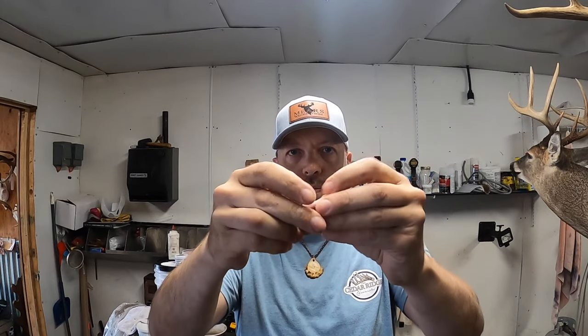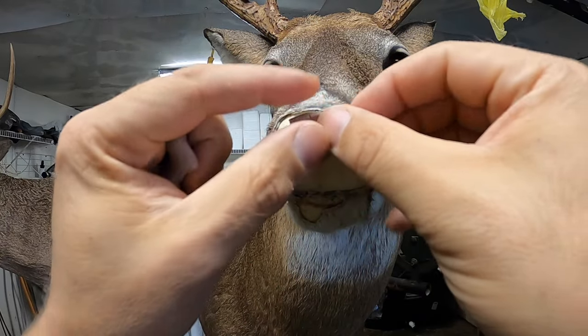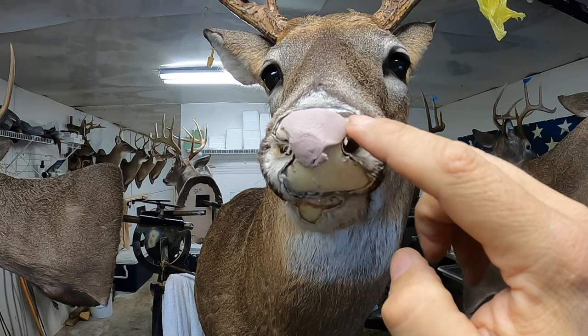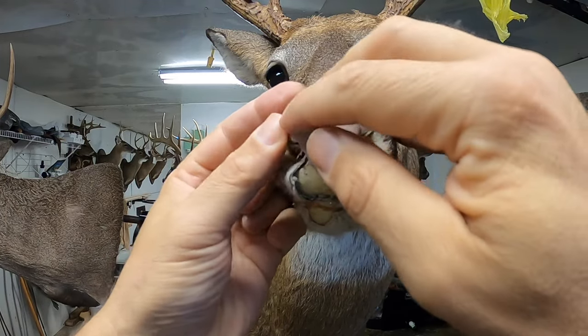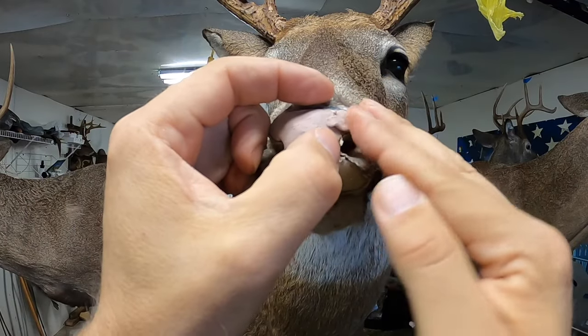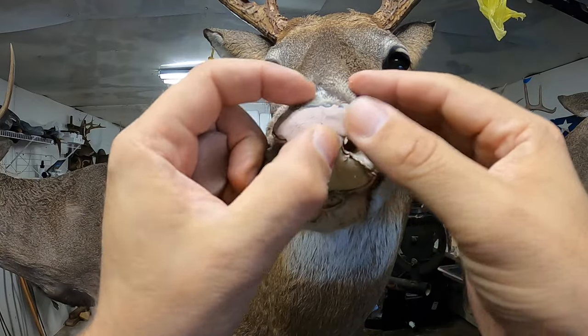Just take two parts like that right there. I usually roll it out kind of like an earthworm — twist them together and just mix it. We're gonna take this and fill this in right up along the edge of that skin and get it back to that same thickness. Fill in what was removed, and then we're gonna slightly overlap the edges so that we can smooth that over and blend it in.